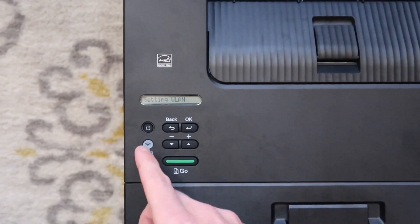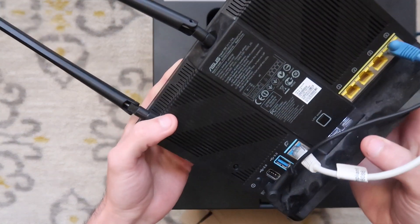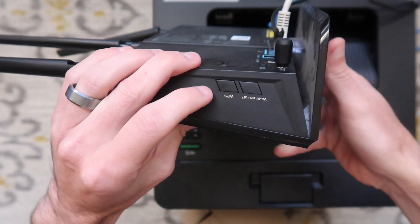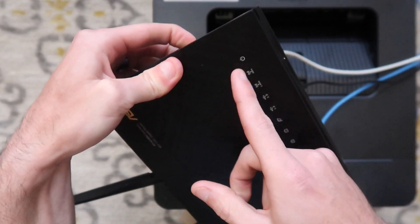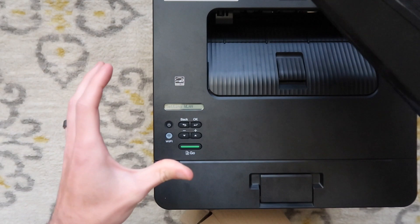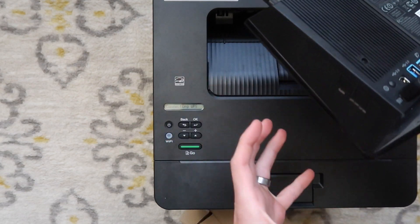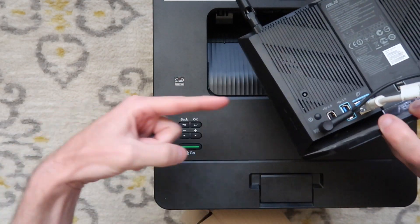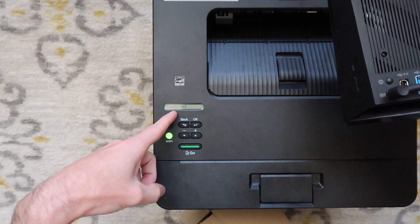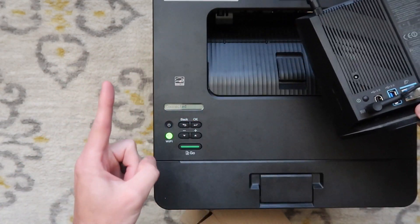Our Wi-Fi button is blinking and I'm going to go over to my router. I have an ASUS RT-AC68U with a WPS button on the side. I'm going to hold that down — my power button is going to start blinking, that's how it works on ASUS, but your router may vary. If you don't know how the WPS button works on your router, you might have to Google that. Now it is connecting the printer to the router using the WPS feature. You can see it says Connected. The printer is on the network — that is Method 1.